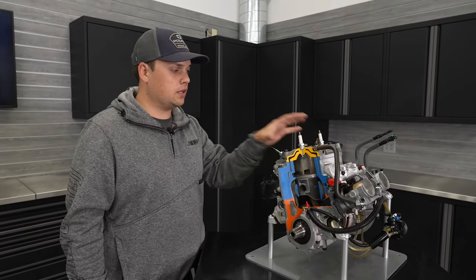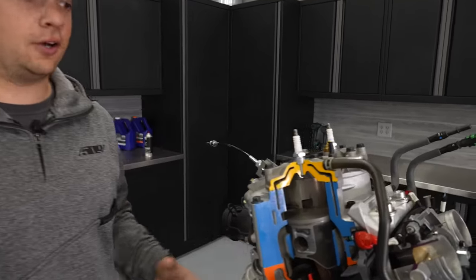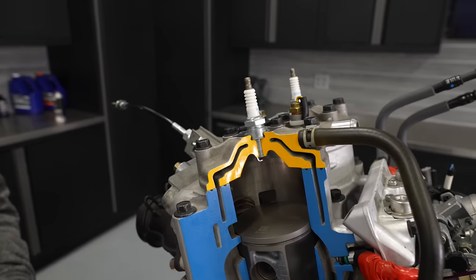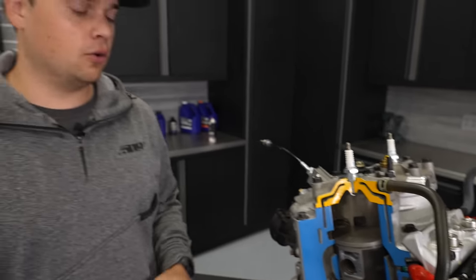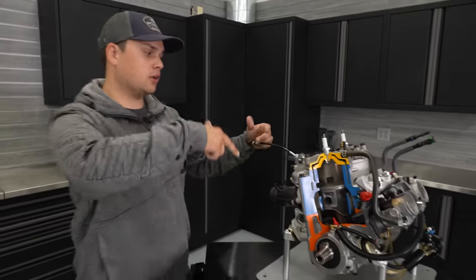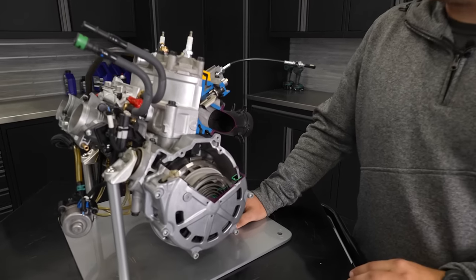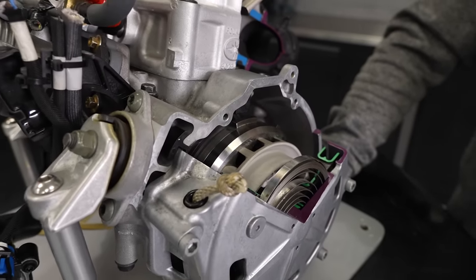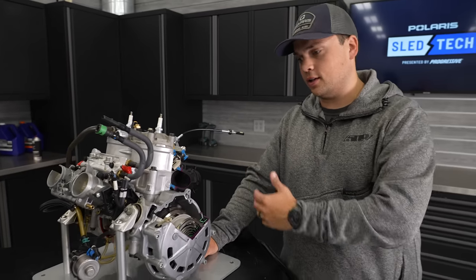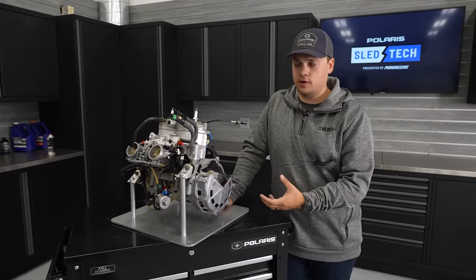Moving up to the head: it's a one-piece head design, so it's stronger and has more cooling capacity, keeping the engine at the proper temperature. Snowmobile engines live a really hard life managing temperatures, the cooling system, the conditions they're in, and the power levels they're making at the RPM they run. Coming around to the mag side: a lighter flywheel, keeping the low inertia of the engine, and then a bigger stator — more stator power without adding a ton of weight. With the Patriot platform adding things like the 7S display, more stator output without sacrificing weight was key.